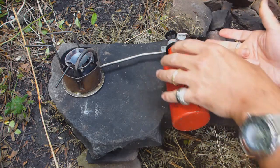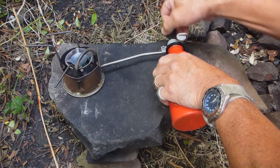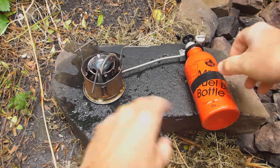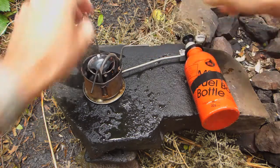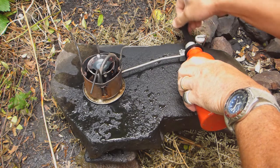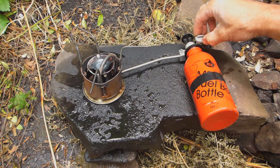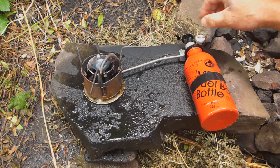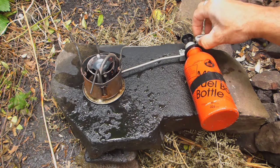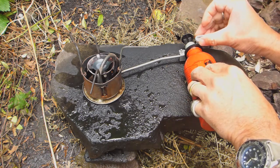No leakage on there — that's really important. Now I'm going to open up the valve. I just spilled a bit of kero there so I want to be careful. I'll pressurize it a bit more to get some fuel into the priming cup. Close that off. Make sure we've got no leaks anywhere.